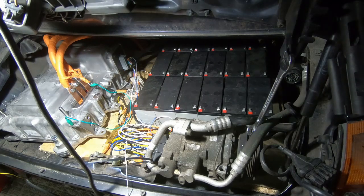Okay, so we've got space for about 18 batteries — 18 batteries. They're 12 volts, I think 6 or 7 amp-hour, something ridiculously low like that. So that gives us a nominal voltage of about 216 volts. It's not exactly high power, but should be enough to get things spinning.